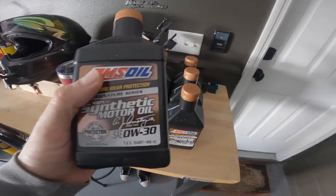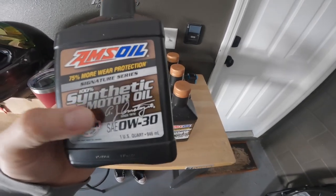In my case, BMW has told owners of this vehicle to put in 0W20. Why am I putting in 0W30? Because I have a highly modified Mini Cooper with a highly modified setup. I'm going to be tracking my Mini Cooper and I do run it pretty hard. That is why I'm going with a 0W30 — so it operates effectively at a higher temperature. It's better for my turbo and better for my internals.